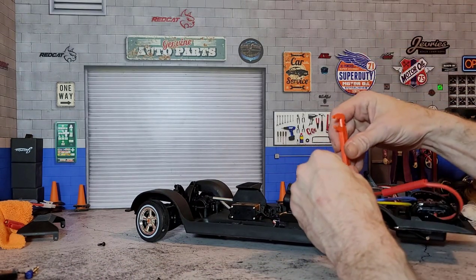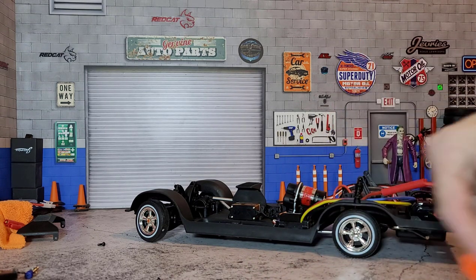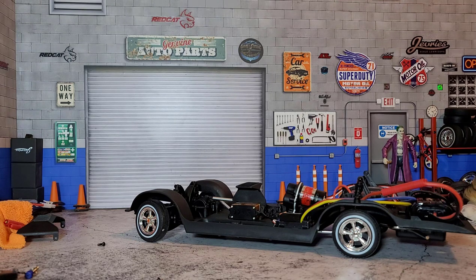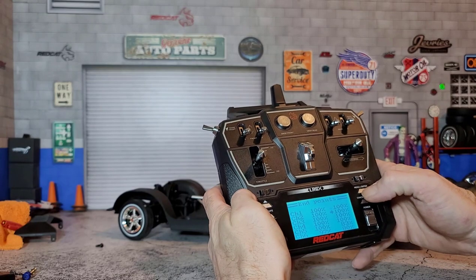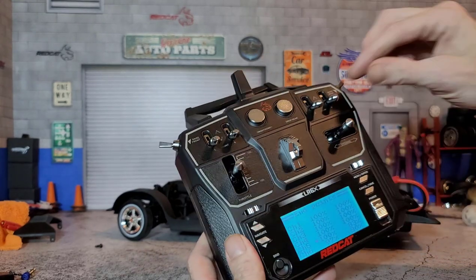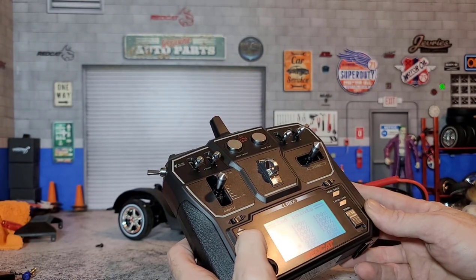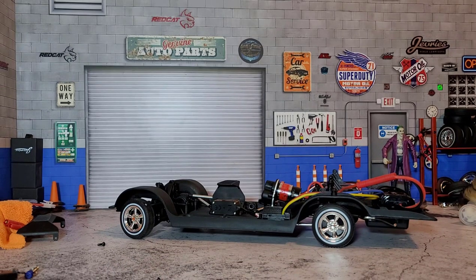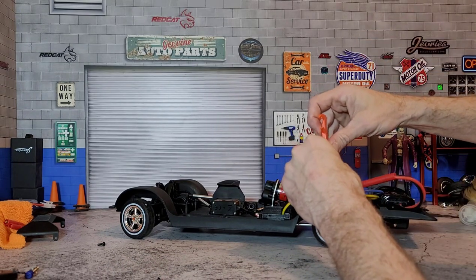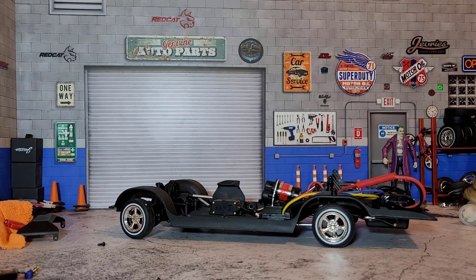Now we're gonna bring this one up. So because we're moving on back to channel number 5, we've got to switch this over to channel number 5. And we're working on the low side, making sure sticks are down. And we're just going to reduce this number. It's probably going to be around 80. Let's see. That looks a little far. Yeah, that's a little far. That's 10. So we're going to bring this down a little bit more.